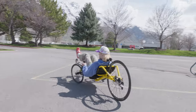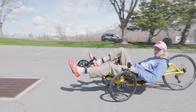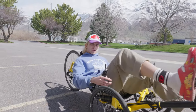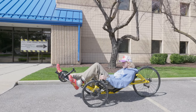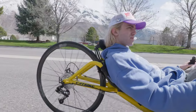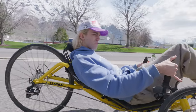Now that you've given your trike a good once-over and fixed any parts that may have taken some weathering during the winter, it's time to do a preliminary test ride. As you take your trike out for its first ride, be alert and conscious of how the ride feels, on the lookout for anything acting strange. Make sure your brakes are still in good condition — ride around and test them, ensuring there's no difficulty coming to a complete stop. Also take tight turns and watch for tires rubbing the brakes as you maneuver. Run through your gearing going up and down the shifter; adjusting gears may be a little choppy at first, but they'll usually loosen up after a couple of cycles.